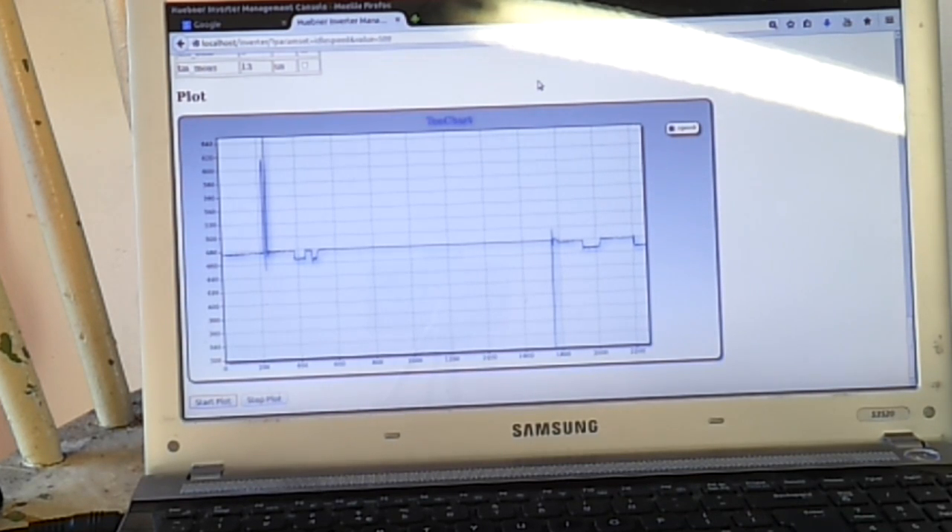You can hear the box loading up. It's purely proportional control in software at the minute. Back to neutral. This is an amazing inverter platform — I built this in about a week of evenings and it just works. Let's pop it into drive, first gear. Here comes second gear — you can see the little dip in the RPMs.